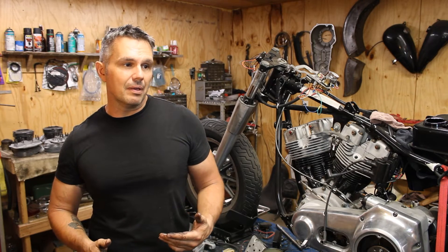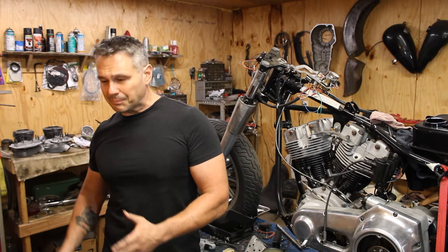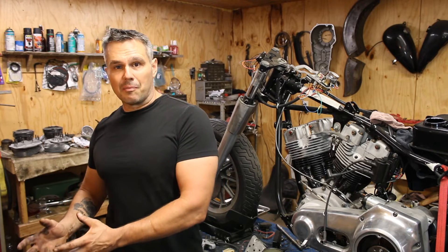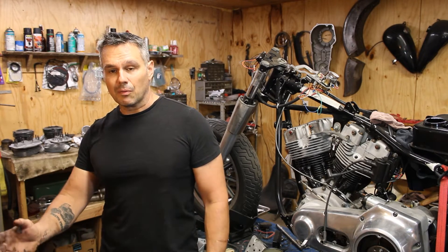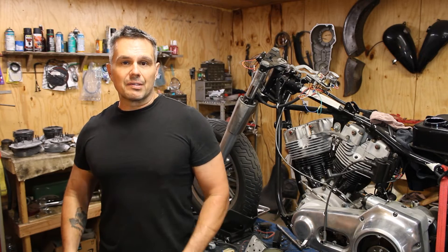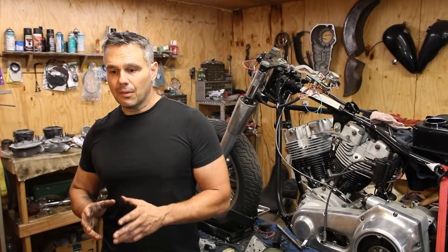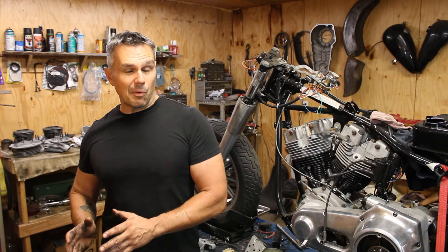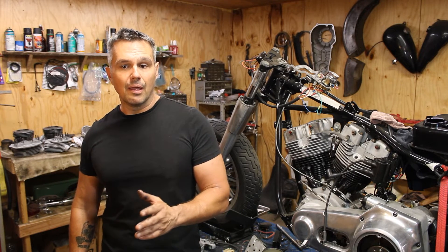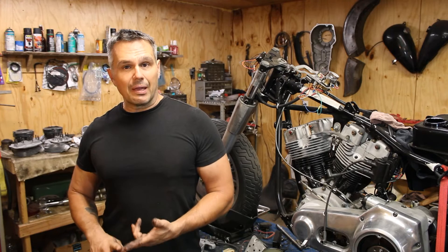So let me tell y'all what my hypothesis is — leave a comment if you have a different idea or know something I'm missing. Due to the fact that the left gas tank was damaged pretty badly — when the fire burned the paint off I saw the Bondo and how deep it was — I got all that off, cut the weld seam, worked the dents out, and welded it back. All the sheet metal is 1950. I think this bike had one original owner, and that back in late '52 or early '53 he had a wreck.